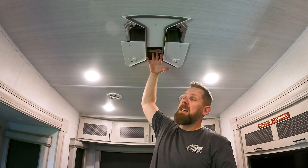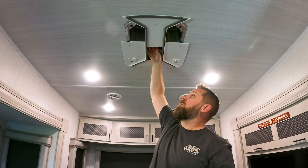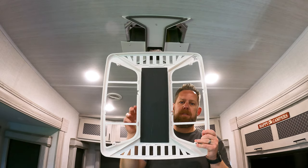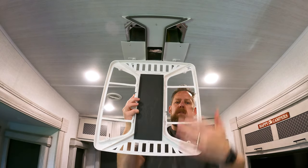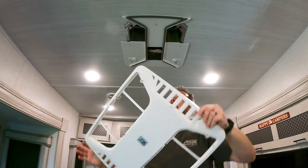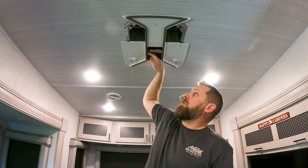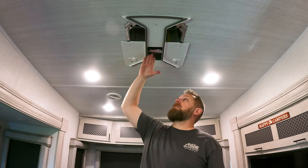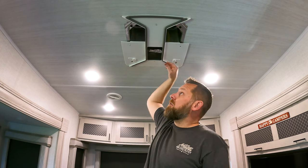I want to show you — you have a return side and a supply side. The supply side is what's pushing the air down. In the standard configuration, air is forced from the supply down through this small chamber, hits the top of the outside cover, and either pushes along this channel through your two dumps or, when those are closed, forces it back up and through ducts on either side. It's not a very efficient use, and what the airflow system does is take all that out of play and force the air 100% from here directly to your ducts.